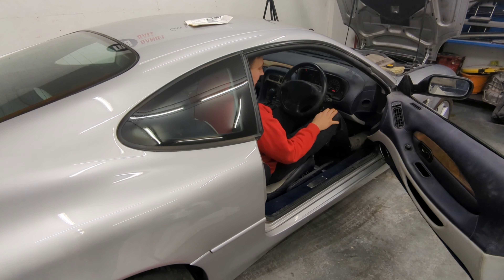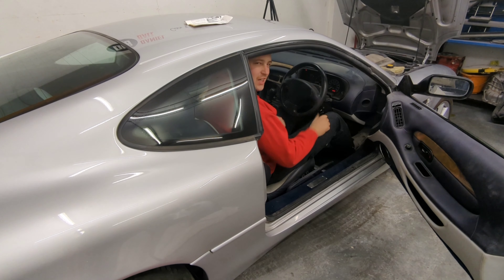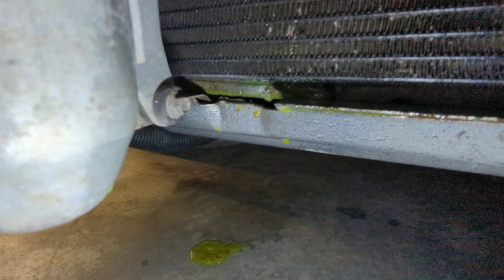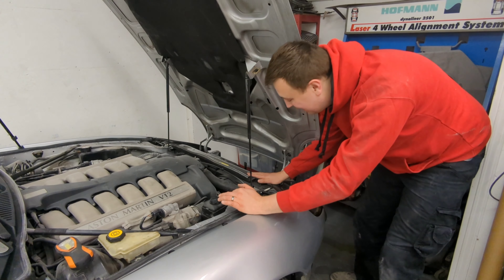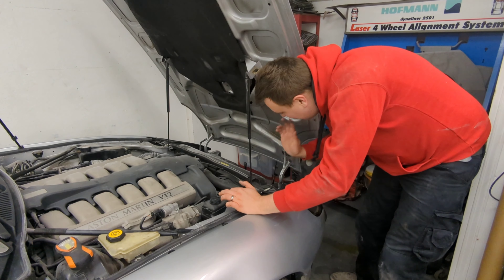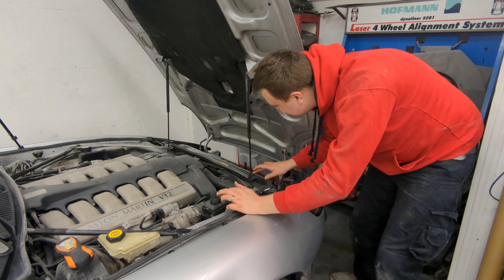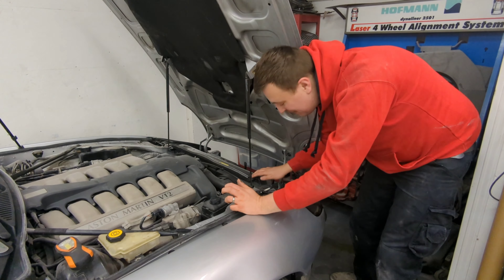It's getting up to temperature nicely. Can't beat a V12. And there we go — I've just rubbed the bottom of the radiator on my finger and it started pouring out. So yeah, conclusive — we found the fault. The rad's got to come out, which I really didn't want to have to do. But such is life. Silver lining — this panel that goes across the top is in not very good condition, and it's got to come out for the rad to come out, so it's a good opportunity to repaint it.